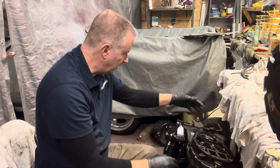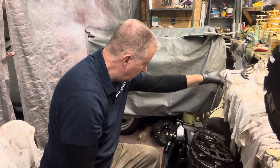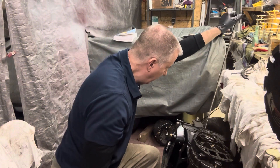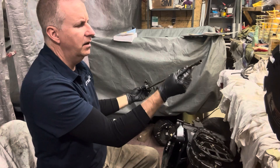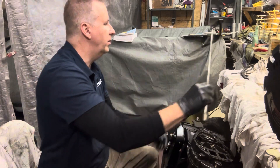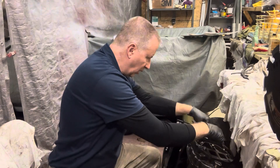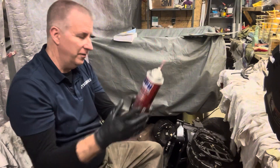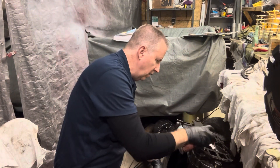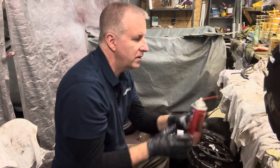We're going to get into this. I'm just going to take this bracket off here — our shift shaft. It comes through; it looks like it comes all the way out. Good thing we can look at that and inspect it. It doesn't look corroded or anything, so we'll put that aside. We're going to take this bracket off — I see some bolts here. We're going to juice them up with some Jack-of-all spray, my favorite stuff, and we'll start pulling this apart.